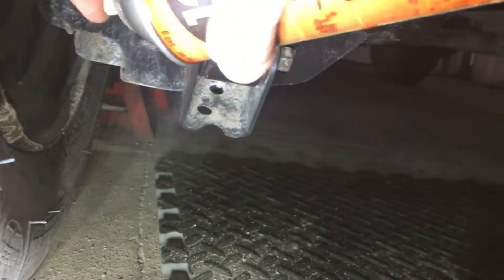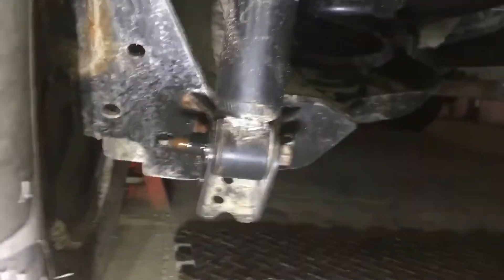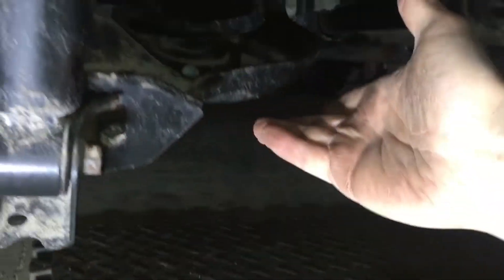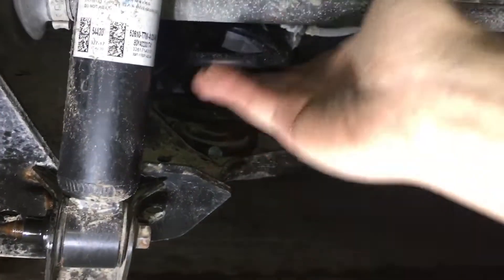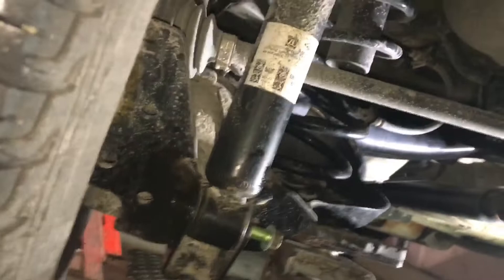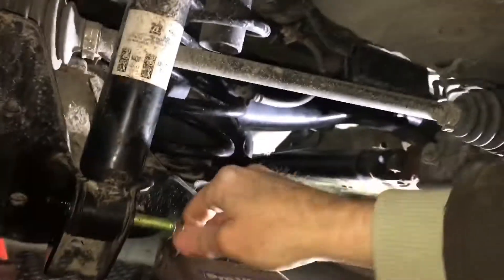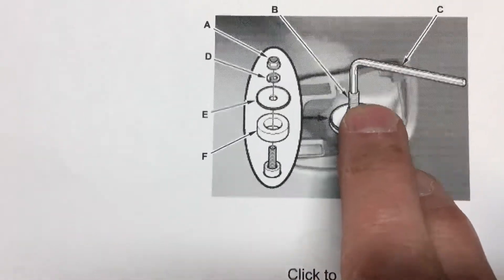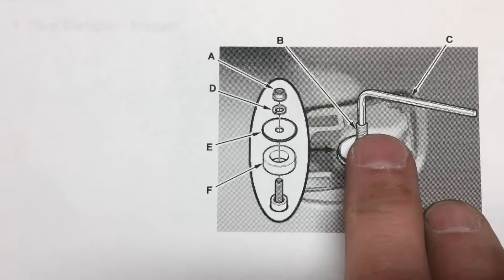Don't place it under the central axle, just under the saddle for the spring seat. Raise the floor jack until the suspension begins to compress, then remove the damper bolt. Your choice of penetrating oil on that bolt. And as per the manual, we'll put the jack under the spring saddle, take a wee bit of load off it and do the bolt. The upper side has an internal wrenching hex — I'll figure out what size that is and let you know.